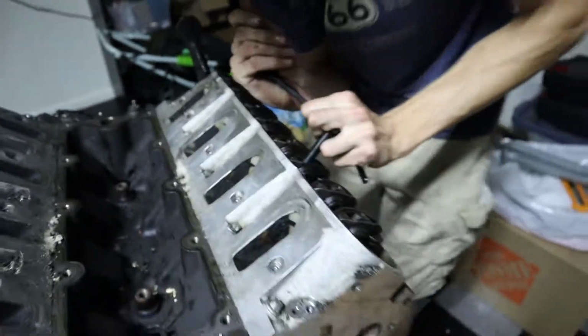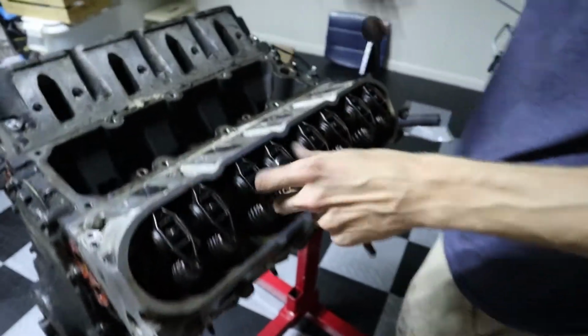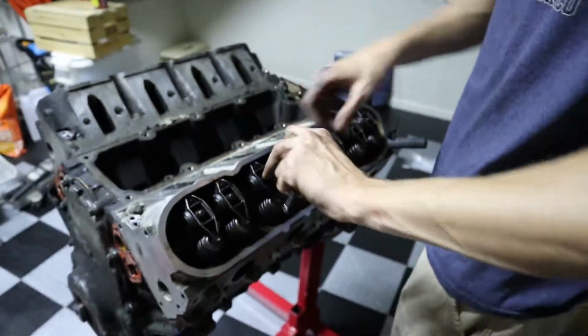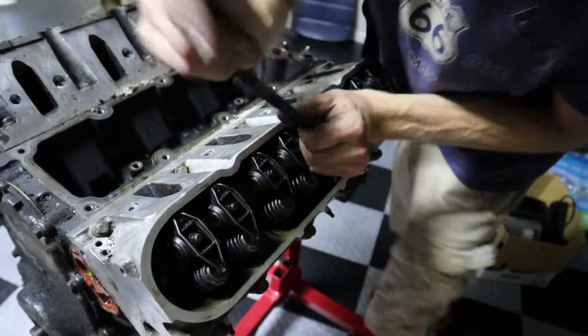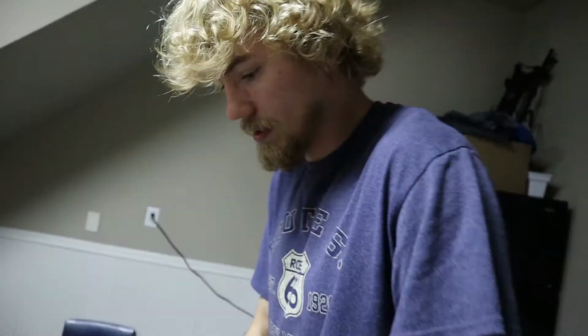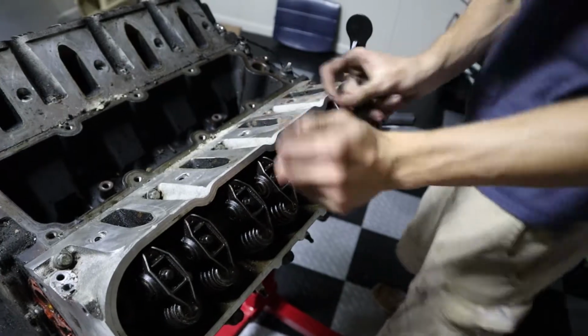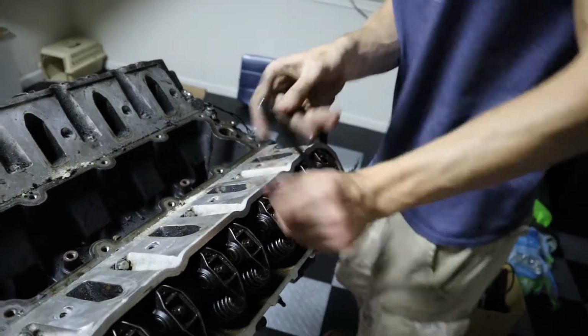And these are the rocker arms, right? Yes, these are rocker arms. Common failure point on these, because they have what's called a trunnion bearing, I believe it's made out of graphite in here. That will start to wear, especially at high RPMs. Luckily, this is a truck motor. Truck motors don't see high RPMs that much. But when you go to high performance, you can get a roller rocker set, delete that. It's just bulletproofing the motor. Is it technically bulletproofing? Bulletproofing, yeah. You're taking out any failure point.